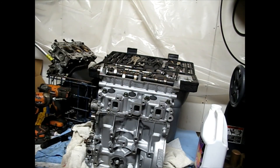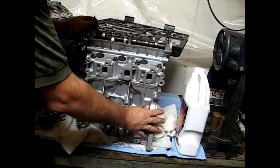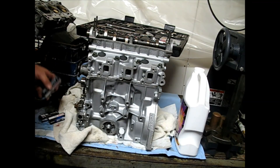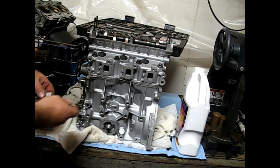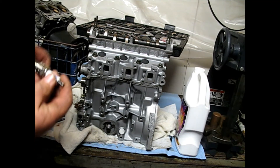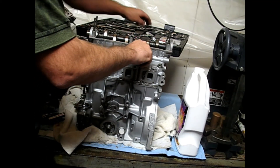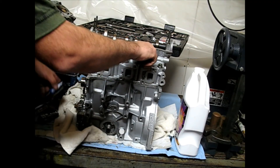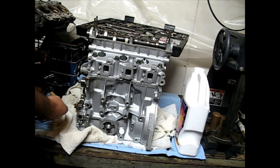Bring it back when we've got them all torqued. Cylinder head is all torqued down to spec, all the bolts. I'm just going to throw the spark plugs in the holes — I'm concerned about debris getting in there now that I don't have a way to check or get it back out. So I'm just loosely threading these in just so nothing falls, drips, or crawls in. Keep it nice.